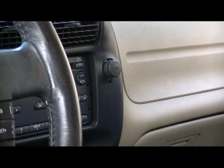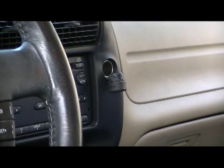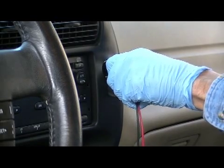In this case, I am using the in-car power as a source of power for the CDR interface. For that reason, I am going to plug the repowering rig into an accessory receptacle in the vehicle. I always need to make sure I use the same source of power for both the CDR interface module and the ACM. Remember, normally the last step would be to apply power or turn on the ignition key. So in this case, I have the software ready to go with case comments and I am ready to collect data. I am going to plug the repowering rig into the accessory receptacle and then click the collect ACM data icon.